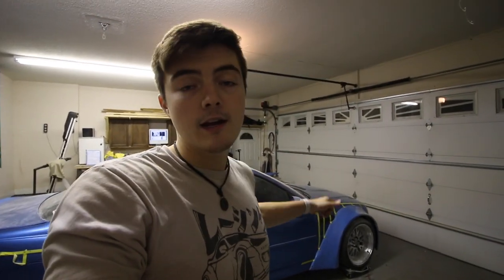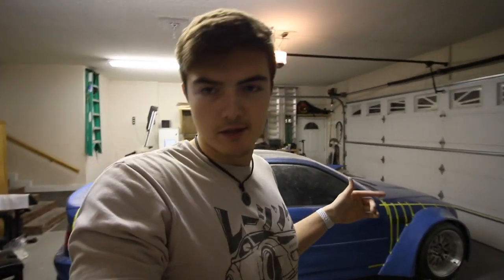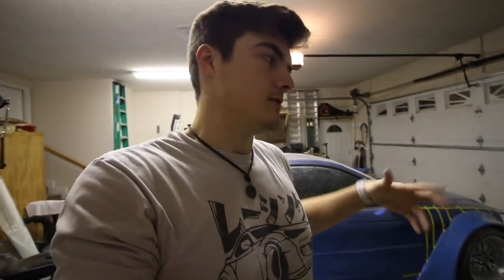All righty guys, so I'm halfway through my part making process. I've got PVA and gel coat on there. I'm about to start my lock layer, so I'm going to mix up some resin. Other things I've done is cut the inside edge of that front passenger fender. I did the same thing to the front driver fender, just not as much. I've still got to continue to shave the outside edge of that, so I'm going to mix up my resin and start my lock layer.